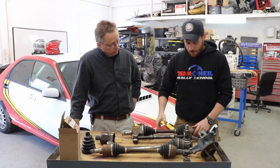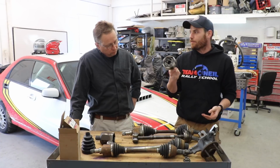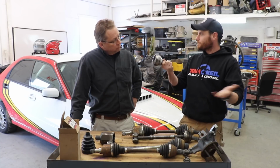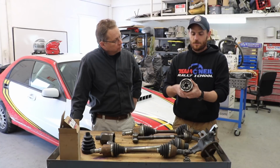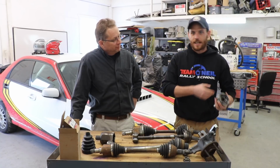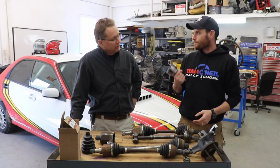And then the lifetime on the parts is just knowing, like a lot of rally car stuff, when this CV axle was replaced, when this CV joint went on the car. If it went on in February, and you did 7 races and blew one up, then you know every 6 races maybe you have to do new CV joints. Because something like this is all it takes: you do all of these long nights and hard work and no pay, and build your rally car and tow it across the country and show up at a race, and halfway through you turn the wheel, hit the gas, the CV joint blows up. Because you didn't fix that.